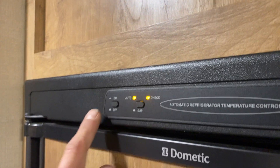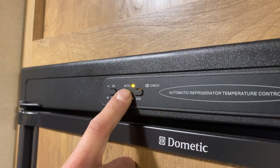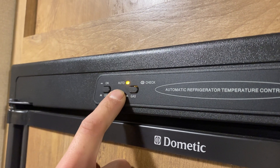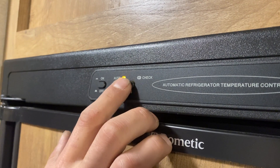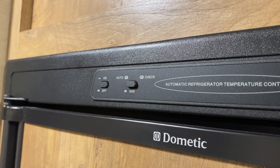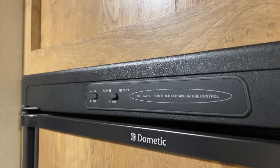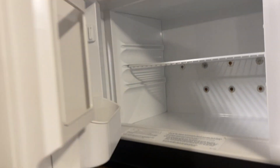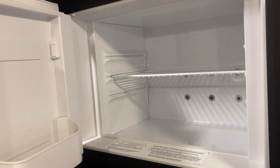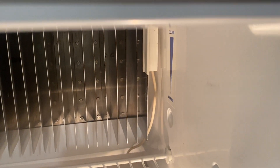Fridge here — power button on the left. With it close to flush, that's it turned on. You'll see it run on auto — auto will first look for AC power, and if AC power is taken away, it'll automatically flip over to gas. If you're out boondocking and want it running solely off gas, have this button on the right come out and it'll run just on gas. If that check light comes on, it's letting you know it hasn't fired up — just turn it off and on to reset it, and if it still doesn't fire up, make sure you've got propane. At the top you've got your freezer, down below the fridge, and the temp control is in the back — as the sticker says, up is colder, down is warmer.